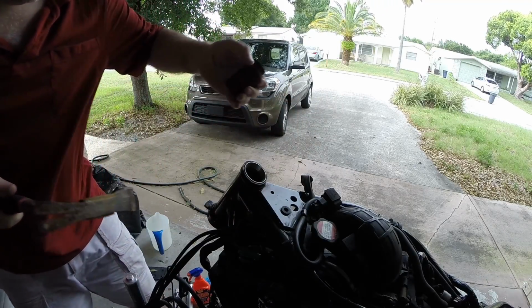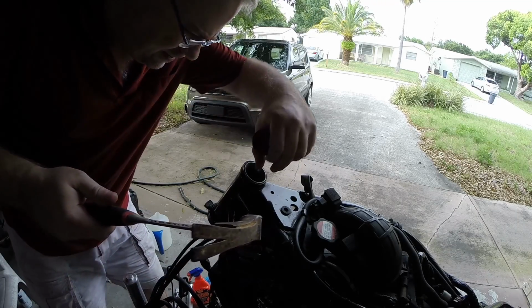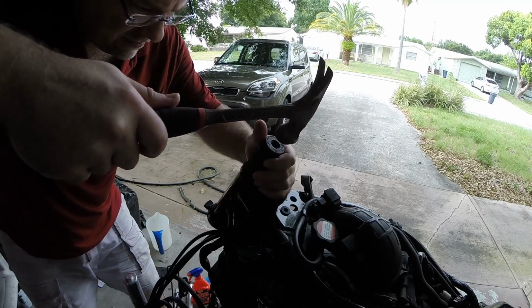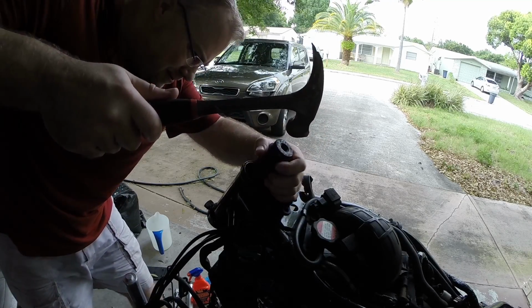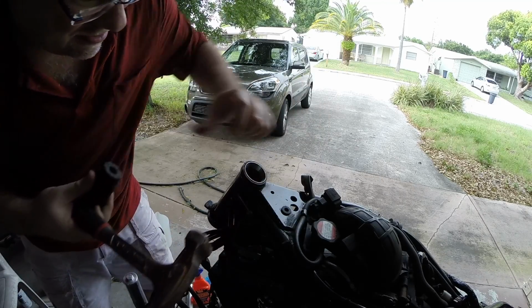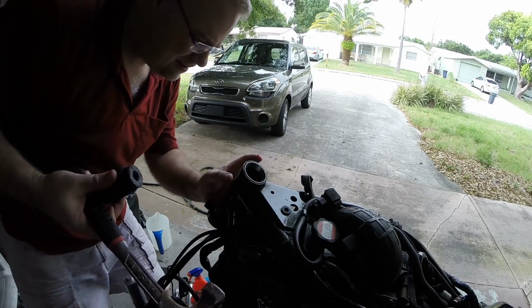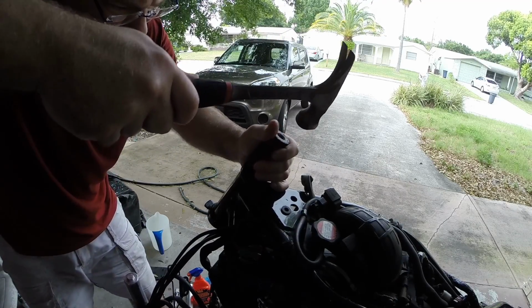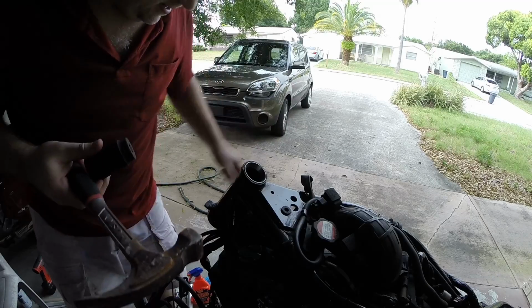Now that we're just flush, you need to be real careful so you're not pounding on the frame. Work it all the way down. You can feel with your finger to where it's seated on the shoulder. It's just a tiny, tiny bit left to go. A couple wraps is all it's going to take. And just make sure it's completely evenly seated, and it is. Maybe a little more on this side right here. There we go. Top done.